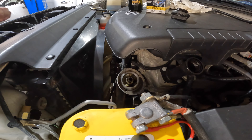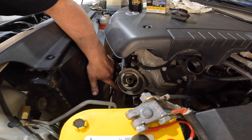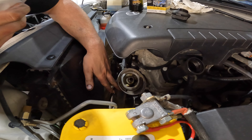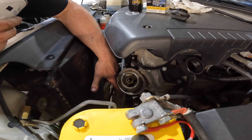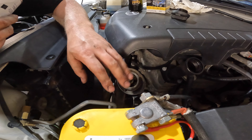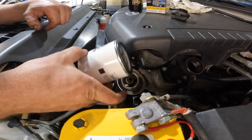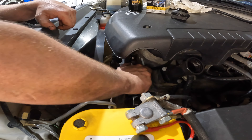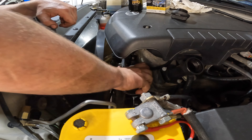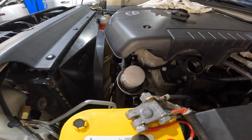You might have just noticed I put a water bottle under here. These are upside-down oil filters — there's a little drain right here. Keep a vacuum cap on that and put a water bottle underneath so it doesn't get all over your engine. You just lube up the bottom like any other oil filter, spin it on there, give it about a crank — whatever feels good to you — and call it good. Now we're gonna lift it up.